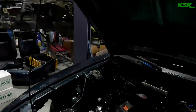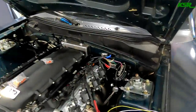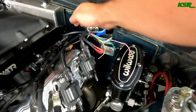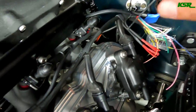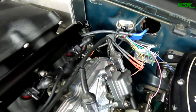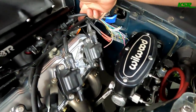We've got some lights back here that we rarely use but they help with undercarriage work. There's a quick-disconnect firewall connector here, and this is all coil power. There's also a plug for the injectors down here. The reason there's a connector there is so the intake manifold can be taken off quickly — instead of having to remove all the individual electrical connections, you just use that quick disconnect.